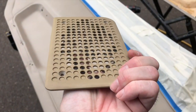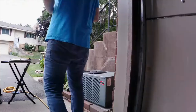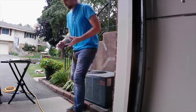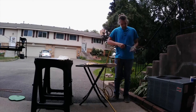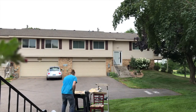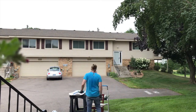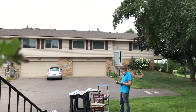Here are the factory speaker grills — they looked the worst, actually worse than any other panel inside the car. I'm not sure if the plastic is different on them. Here I am sanding them with wet-dry sandpaper, then washing and cleaning them off, drying them with the air hose, and then I brought everything out and got the SEM paint and started painting.